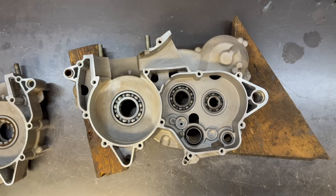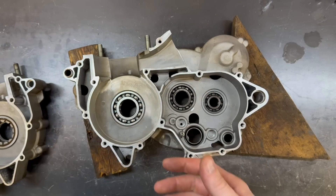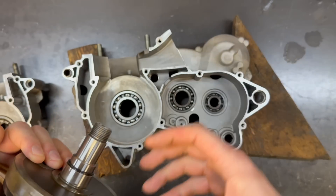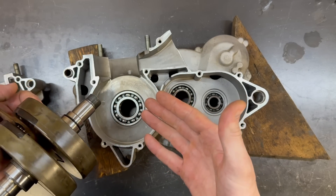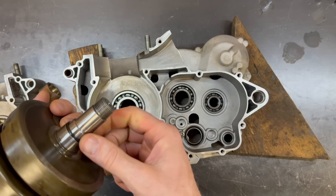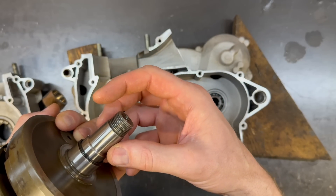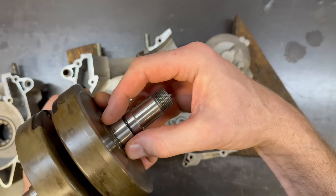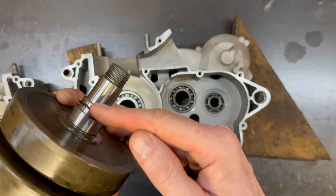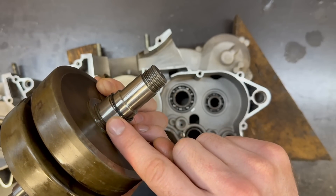Now, you guys all know that I love concepts, so let's get into how this crank system is designed and how it works. On the right side of this crankshaft, you can see that there are threads — these are left-hand reverse threads. What's going to happen in the stock engine and in this right side case half is the crank is going to drop into the bearing, and it will be a slip fit on this side. Then there's a series of gears and spacers here, and the nut pulls the crank into that bearing, and it locks the bearing between the crank here and the collar that goes on this side of it.